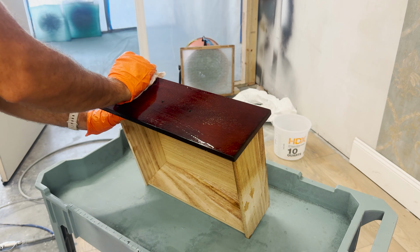Sometimes I just try to make sure that my first coat is a little bit thinner. That way, it'll dry faster, and there's less of a chance that it'll lift the previous coating because it is pretty hot. It's a lacquer-based product, so it's just something you have to think about. I can't give you every specific circumstance where this primer would work, but if you're worried about it, then I might use a 2K primer that's either water-based or solvent-based, something that's just not as hot as a lacquer.